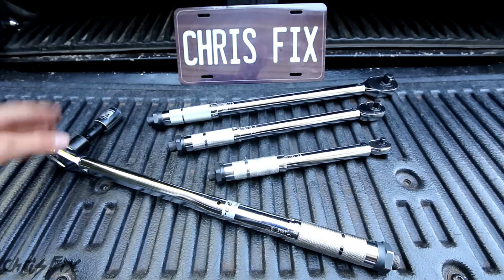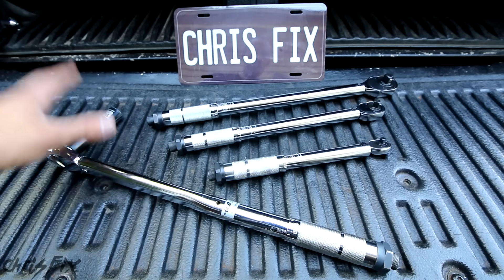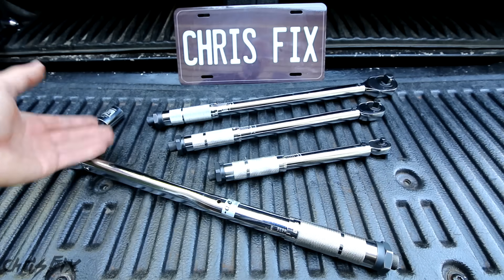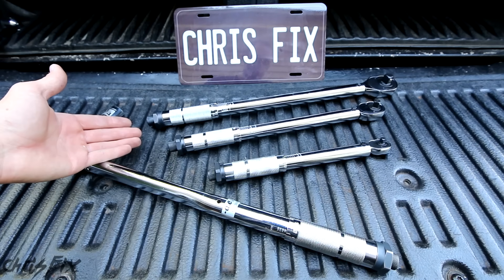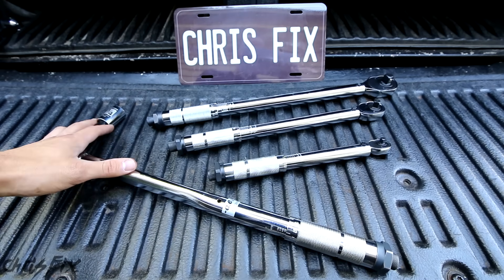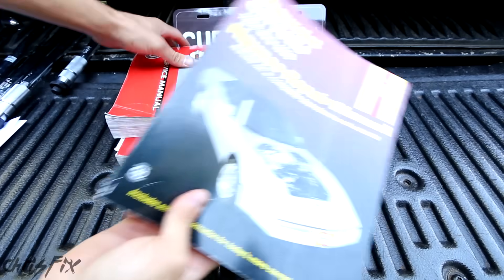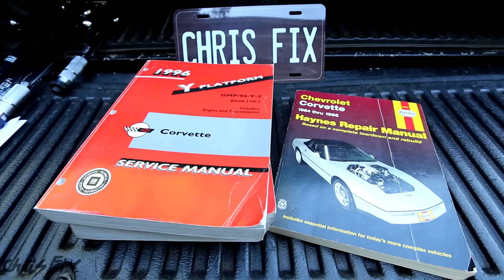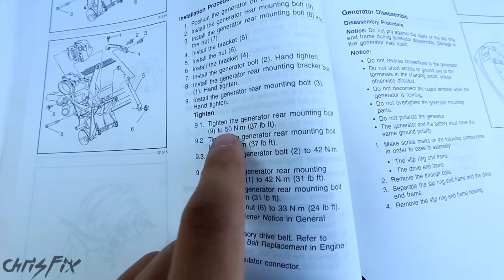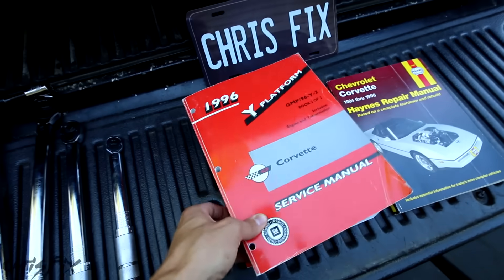And that's really all there is to it, it's very simple to do, nothing complex at all. As easy as these things are to use, there are a lot of top tips that I could give you, such as where do I get my torque specs? How do you take care of these? Where do you store them? What about the calibration? Can I use extensions? And another big question is, where do I get a good torque wrench? So the first top tip I want to cover is where do I get my torque specs? This is where I get my torque specs from. I buy service manuals for the cars I own because I know I'm going to work on them. In the service manual it tells you the basic steps to repair the part, and it gives you the torque specs for the nuts and bolts that you're going to tighten down.